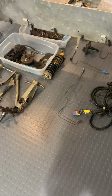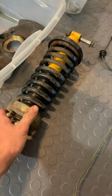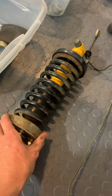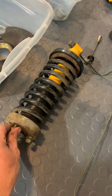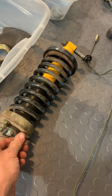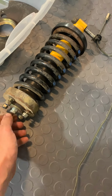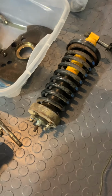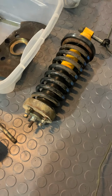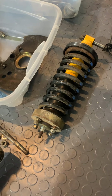But the shocks. I talked with Joe at JAE, and he's going to look into maybe the E-box shocks that they make for the car, or I can take these and have them re-powder coated. They are rusting pretty good. There's also a shock company not far from where we live that dynos a bunch of the drag cars we run, so they may have a tapered shock. I can probably send them these springs and they could check the spring rate and maybe find me a tapered shock that'll work, same size. But Joe's checking into some E-box, so we'll see what he finds with that.